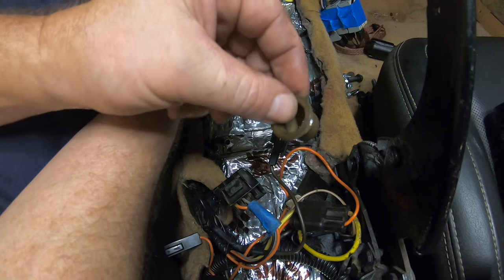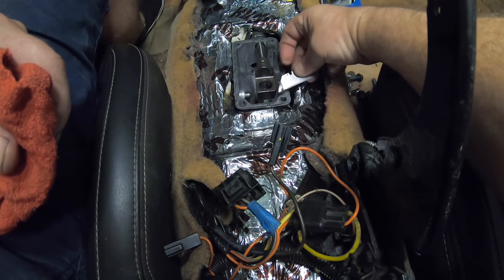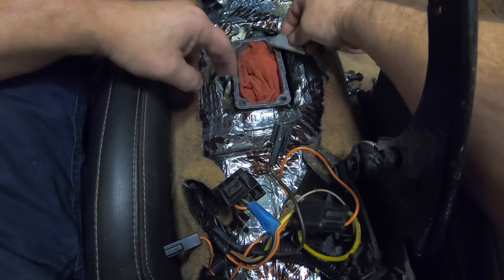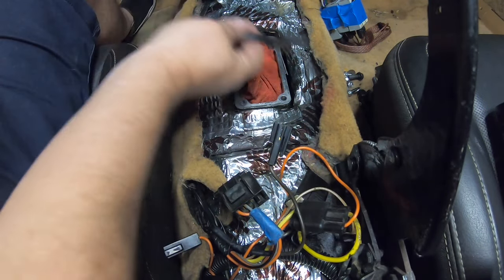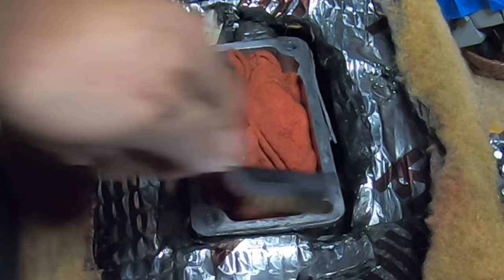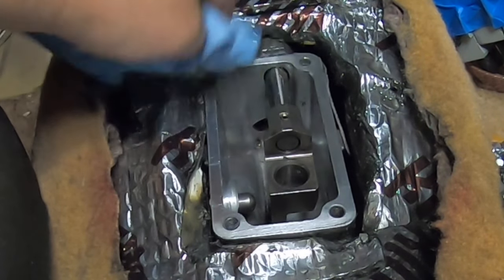Right, there's the cup bushing, the stock one. So we got that out. Any kind of old silicone in the shifter. Carefully, there's not that much left on here, honestly. Then I like to take a soft brass brush like this, that way it doesn't scratch or mar the surface, and go ahead and clean it up from there. Yeah, it comes off nice, it doesn't gouge it. And I'll go ahead and just put a little bit of brake clean, get the final part clean.